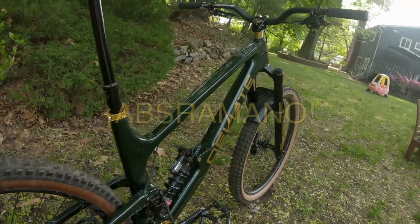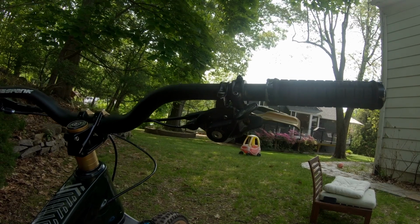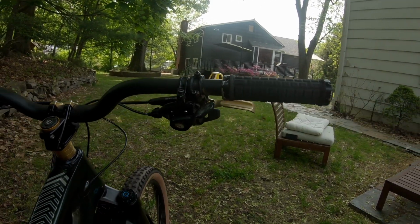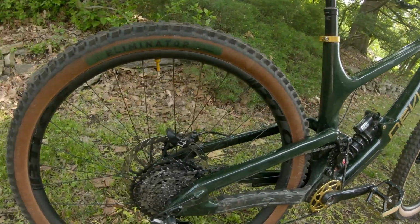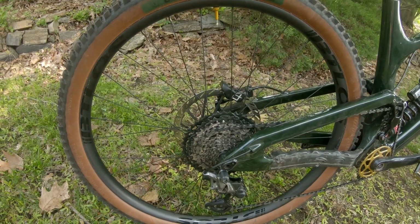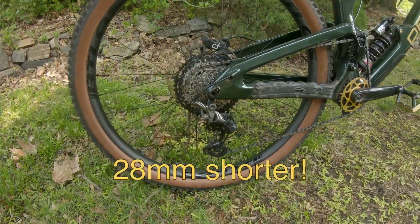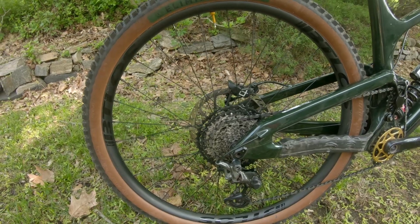Okay, let's talk about this weirdo drivetrain I'm running. Like I said, I've got the SRAM XX1 12-speed shifter up front. Got a screaming deal on that. Was not planning on getting a silly fancy shifter, but it works great with the Shimano setup. And got the XT 45 tooth cassette in the back with an XTR medium cage derailleur. So this thing has a bit more ground clearance, and you lose out on the 51 tooth cog, but who cares? Don't need that.